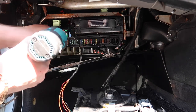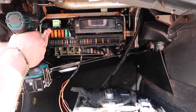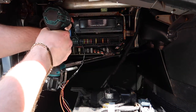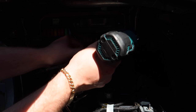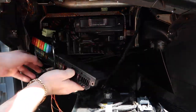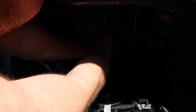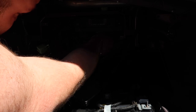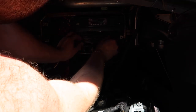This is the fuse box right here and the KBM sits behind all this. We're going to take out these buttons, put them down and take each one out in turn keeping them safe. You may have seen me do this on the 5-Series diesel with a central electronics failure - it's a common issue. The KGM is here and the KBM is this one up here - that's the one we want to target. Put your hand in there, slide the clip back and take it out. There are two little locking tabs here; move the wires out of the way carefully and slide the module out.